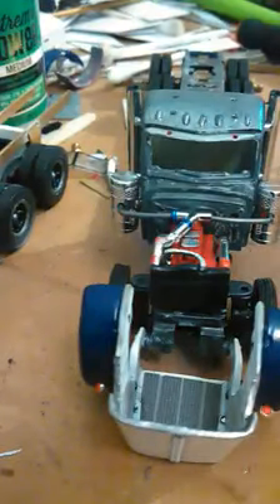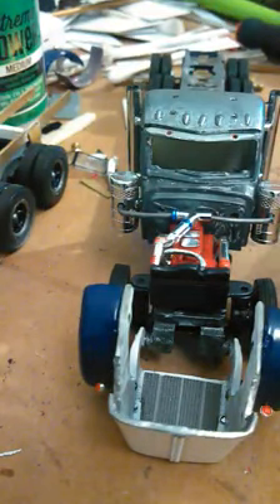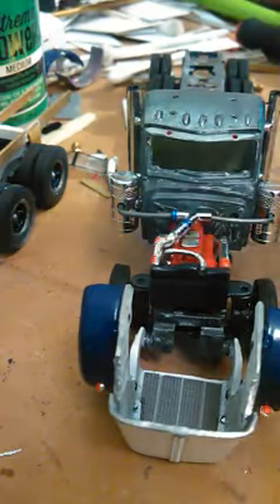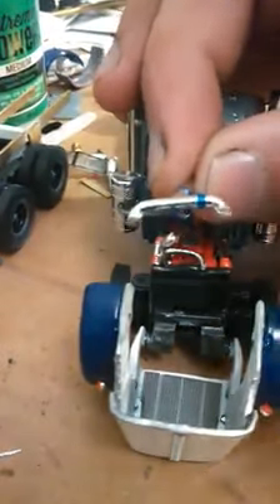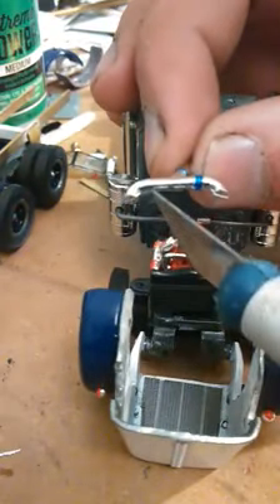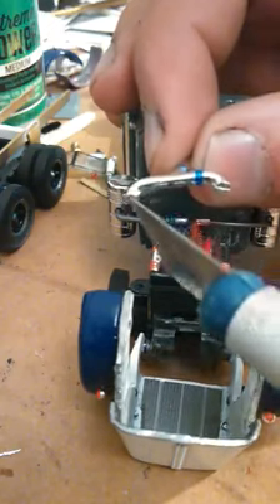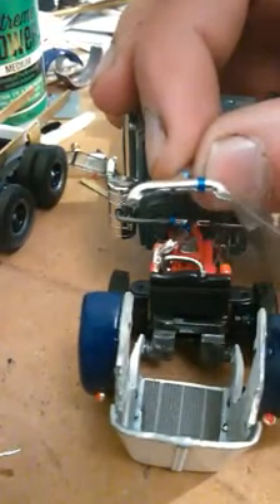This is the 359 short hood. I'm doing another short video on how I run my intake tubing. What I do is take a stock intake tube and cut it right about here and right about here, because these bend down a little bit and you want it straight.